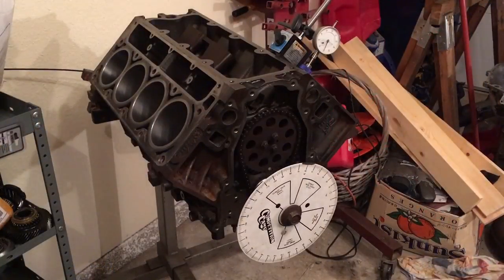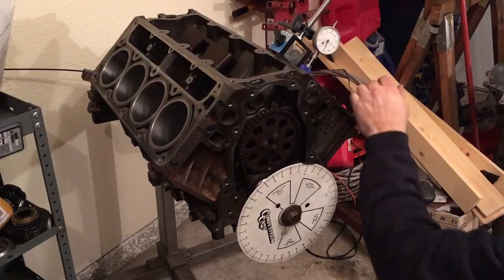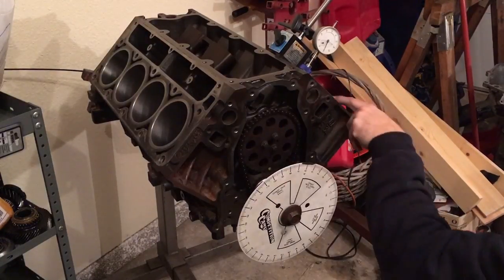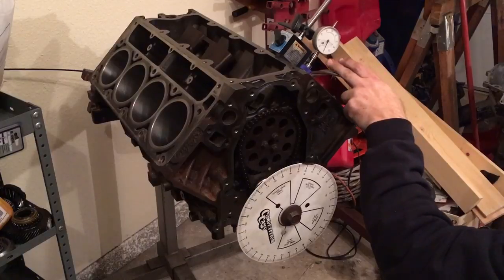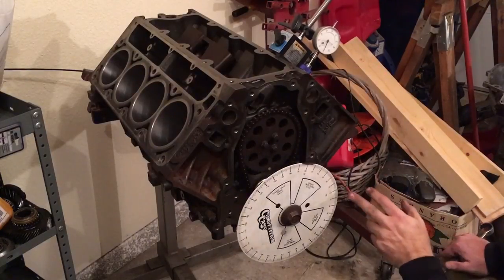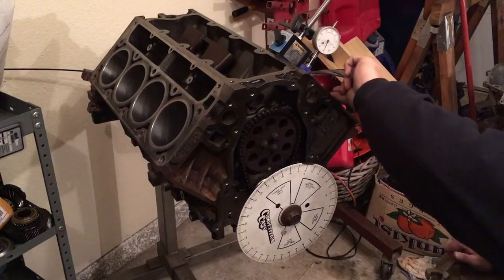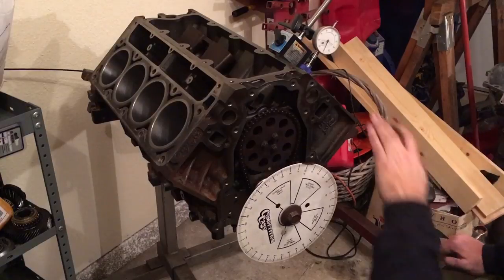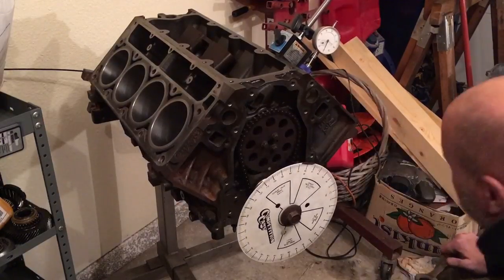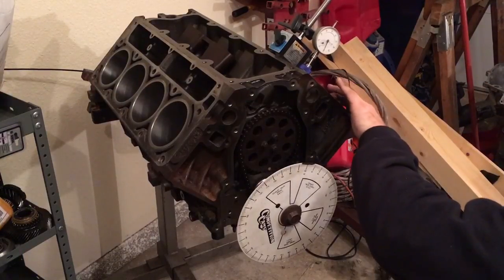Second verse, same as the first. Off camera, I repositioned my magnetic base, zeroed it, and brought this to true TDC, which is really amazing. Because at true top dead center number one, according to this dial indicator and these dots, I am at exactly zero on my wheel — but that piston is slightly above the deck. This is a hundred percent factory motor. That's about as zeroed out as I've ever seen out of a factory engine. It could be a couple thou above the deck.